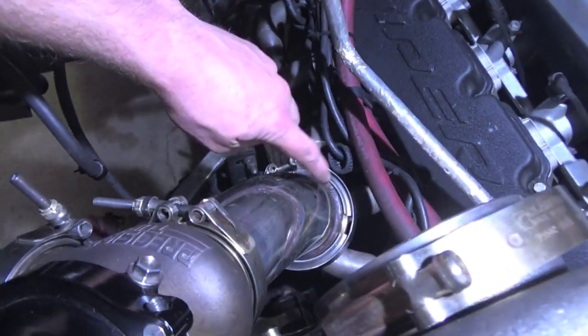Now we're going to pull the full turbo system out, get it out, get it all cleaned up with some acetone, a wire brush, and emery cloth. We're going to take the turbo out, take the manifold out, take the cross pipe off, and weld in the bung for the O2 sensor. I got my wire extensions in the mail so we'll get that all hooked up. Get it all painted and then hopefully tomorrow we can put it all back together and go for a good test drive. Fingers crossed.